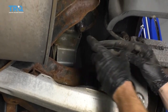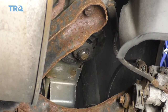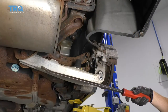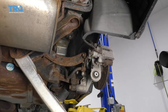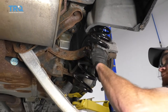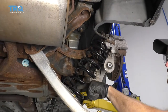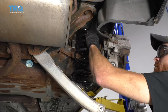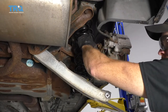I'm gonna line up that mark right here and put that up there as well — they slid right in. Let's grab our new spring and get ready for our install. Grab a nice long bar like this, come straight in through this control arm, and that'll help you pry this right down. Grab your new spring, set it on here. We want to make sure that it ends right where we marked it — that's super important. I'm gonna start lining this up, and that looks pretty great right there.